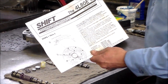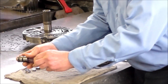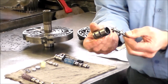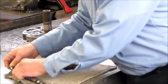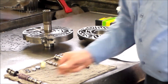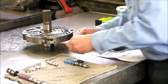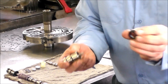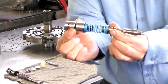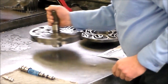Step four: we're going to replace the entire pressure regulator assembly. This new regulator setup gives full-time lube. Here is the old boost valve - there's a lot of wear, and it's very common for this to wear out and cause very high line pressure. Here is the end plug that likes to leak. Here is the new setup: the boost valve, a washer with a shoulder, a bumper spring, and then the valve itself. And the O-ring end plug.